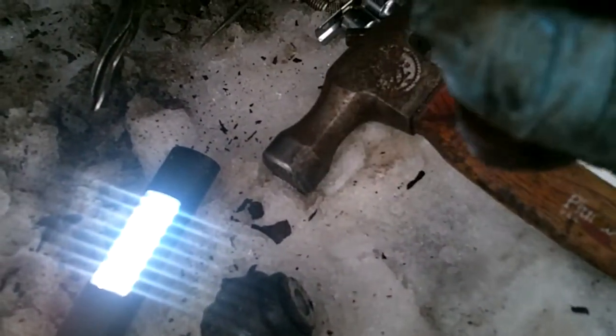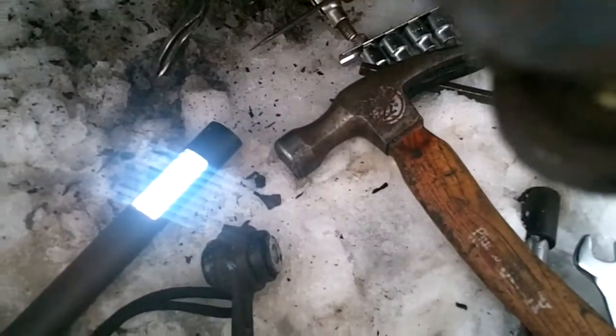On this one, you're going to put the front — it's like a ball joint on the bottom — you're going to put that on first, tighten that up with a 17, and then go to the back and get it lined up in the hole. I'll show you the eccentric bolt. You see the eccentric washer — it's got a slot in it, so these will move with each other in a cam motion to move the arm in and out. If you've marked where the arm was before you pulled it off, trace it with an awl or scratch a little line so you know how far in or out it was on the mount.